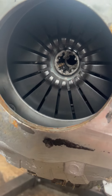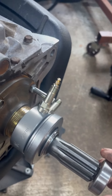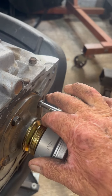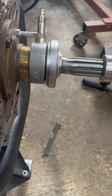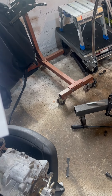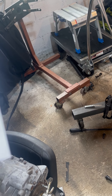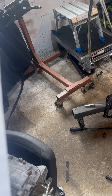I have a bearing up in there too — I bought an extra one just in case. There's still plastic on the clutch in there because I didn't clean it; didn't want to get a bunch of crap on it. This throwout bearing I got from Jegs; I had to shim it — I used all the shims except for three. If you're looking for a T5 one, it comes with directions. The part number is 82876.